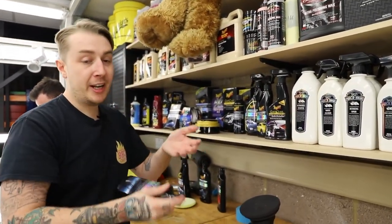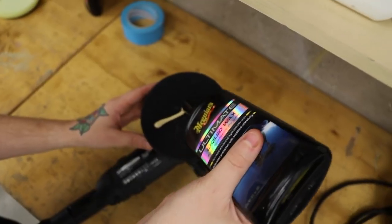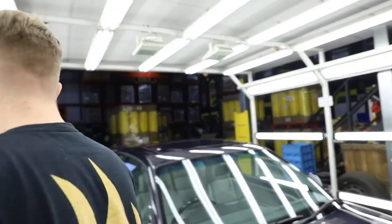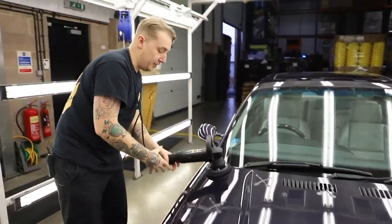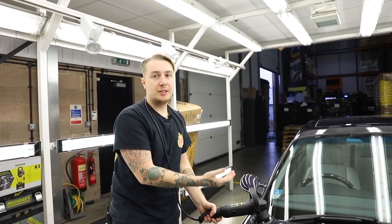We're really backing off from the paint. This is the final step, so it should be the easiest. Light it up and that's it. On our previous steps we did our spreading speed — a slow speed on the machine to apply the product to the surface — and that's all we're doing with the wax. Slowest speed possible. Put the cable over your shoulder, set it to the slowest speed. The slower the machine's going, the faster you can go.